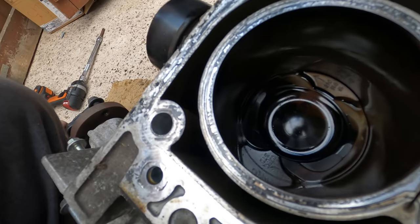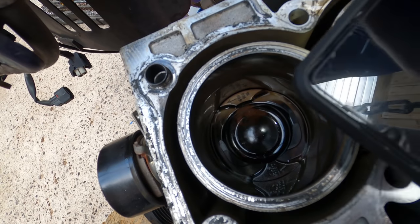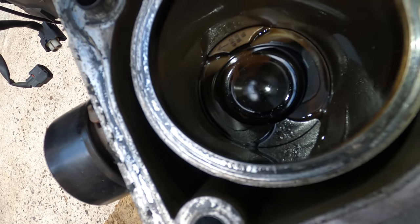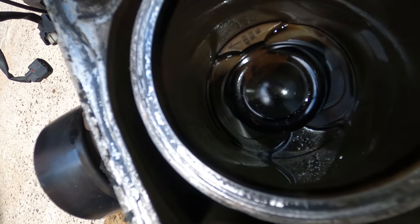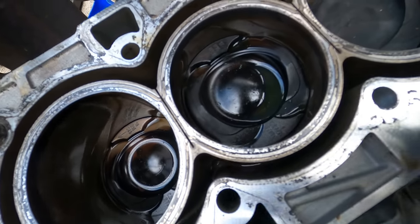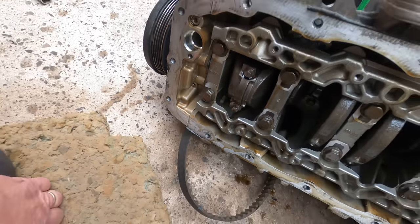The torch has decided to die. The only thing we know for sure is the rings are gone on number one, and that's taken out some of the piston. But right there — there's a suspicious shape on the edge of the piston. I'm assuming they should all be the same shape, but it looks like either a bit has broken off or it's melted away. What we're going to do is get that piston out and have a good look. We just need to crack off these two bolts on the bottom bearing cap and the piston should come out.